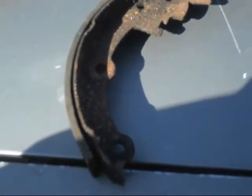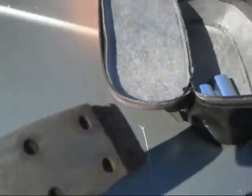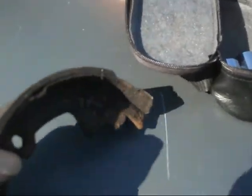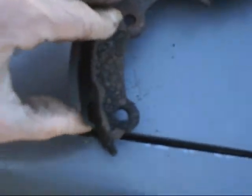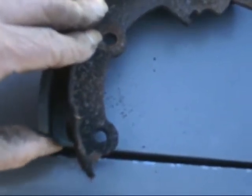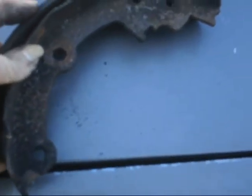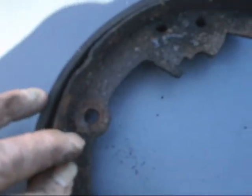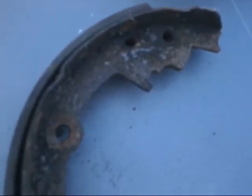Alright, tubers. I don't know whether you can see this or not. This is one of the old shoes — you can see it looks like there's plenty of meat on it, plenty of friction material. But look at this — the rivets for the lining just snapped, they just snapped right away. I have four rivets holding the whole thing together here. And this was making a hell of a clunk — that's why I'm changing the brakes. There was plenty of friction material, it's just that this was broke.